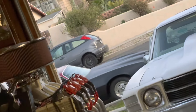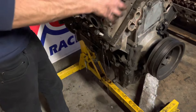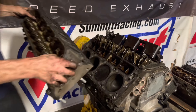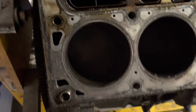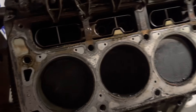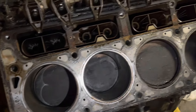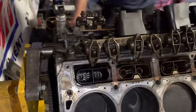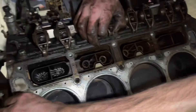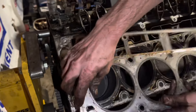Found a little bit of water in there. No pieces of piston though. It's almost impossible to see — let's crack out a flashlight. Yeah, everything looks pretty okay. The motor's stuck because I need to loosen the flex plate, but it all looks pretty good — just like the other one, except it doesn't have a giant gacked deck surface because I actually took these heads off nicely, didn't manhandle them.